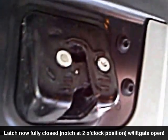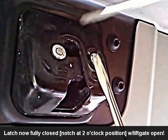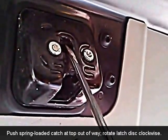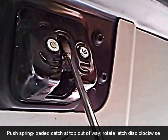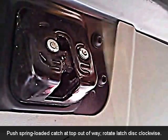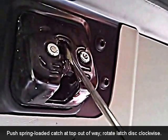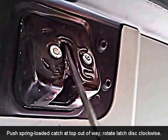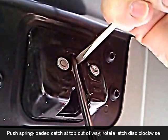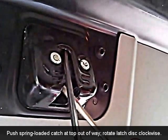That latch isn't enough to tie something onto because it'll slip off, but it would prevent the liftgate from closing automatically — it would already be blocking the main latch at the bottom. So it was manually pushed the rest of the way up. To fix this issue, you're going to need at least one long, flat-bladed, thin screwdriver with a long blade to push that spring-loaded latch out of the way.